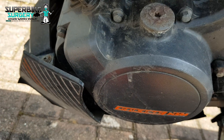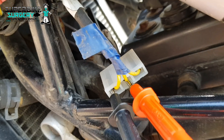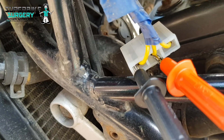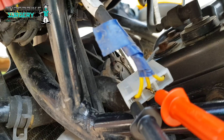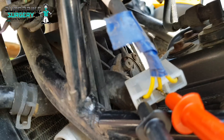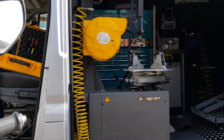Definitely the generator in there has failed. I've got a sneaking suspicion this thing's had a generator replaced before if my memory serves me correctly. Of course the regulator/rectifier also needs to be checked out, but I've already got a reg-rec. I haven't got a generator so I need to get one and come back. Anyway, just thought I'd share that - in the wild in deepest Gloucestershire. Thanks guys, see you on the next one.